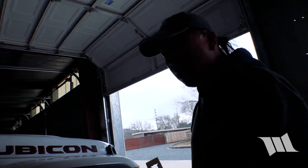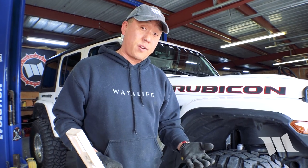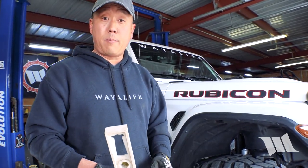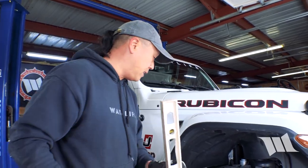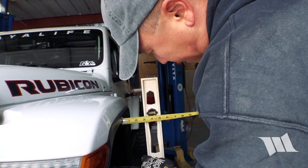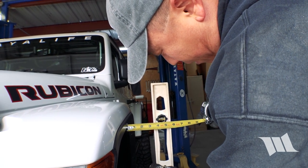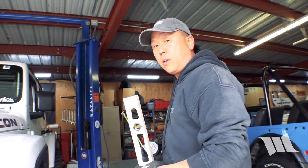Just like we did on the rear, we're going to go ahead and take a measurement of our front axle to see how centered it is. As you may have seen in a previous video, we did install a Rough Country track bar in the past, but I would rather run this Rancho one instead. So we're going to see if we're still on, or if additional adjustments need to be made now that the coils have settled. I'm at about three and three quarters of an inch on one side, and three and a quarter on the other. So we're off by half an inch, and we can make an additional quarter-inch adjustment toward the driver's side.